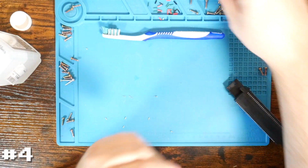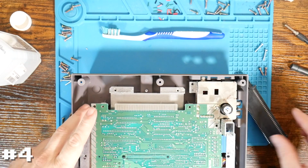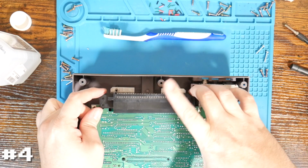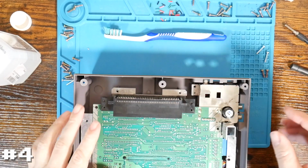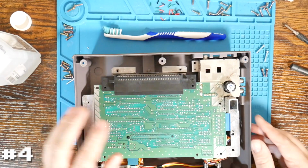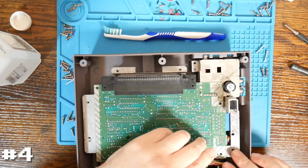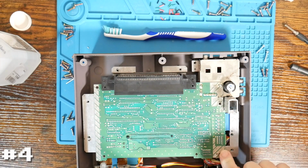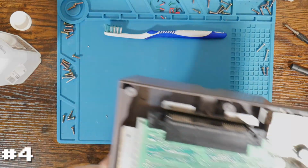So without even having removed any of the cable connectors in here, we'll see if we have to clean the pins on the board. We might do that, but I'm curious if all we need to do just to get it back up and working is just replacing or fixing the pins on that connector. And they didn't install this board correctly at one point, so there is a bent plastic piece in there, but that's fine. Let's move this over to the TV and test it out.